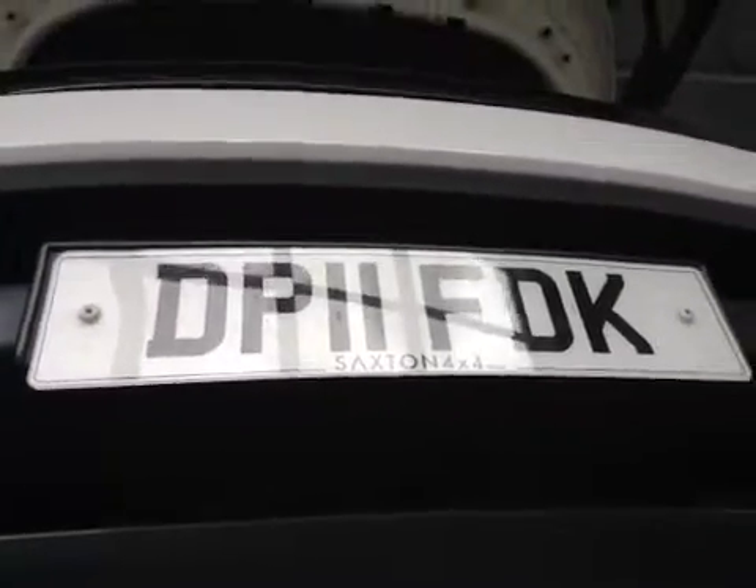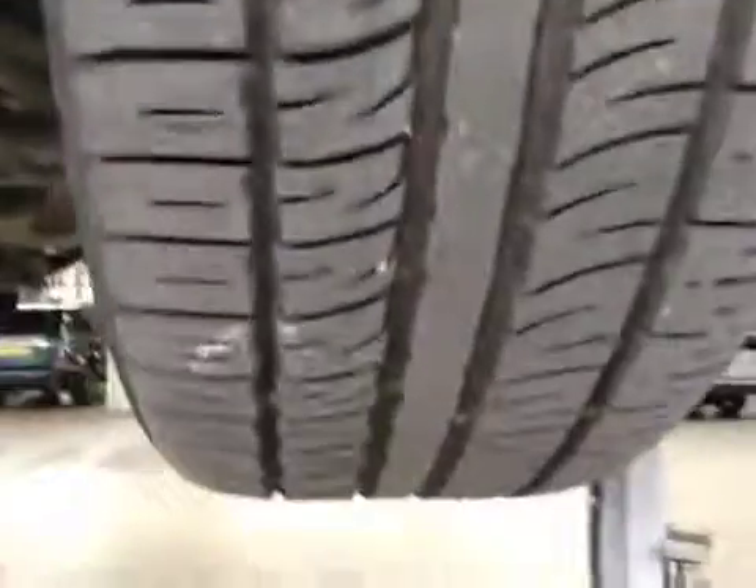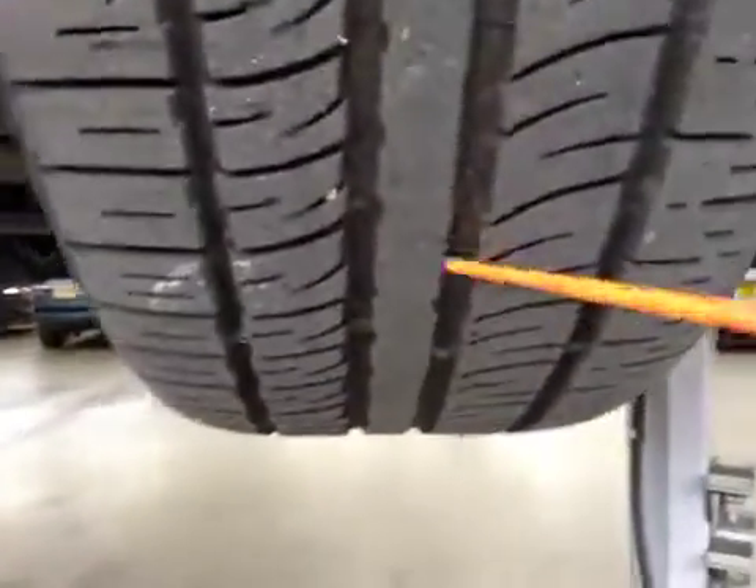Hello, my name is Ian and I'm coming out of the visual inspection on your vehicle. This is the passenger side front tyre. The tyre has about 4mm of tread. There are a few issues with this tyre, so I've marked it in red.